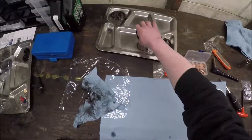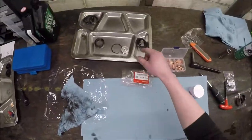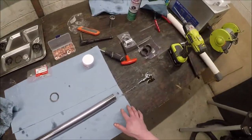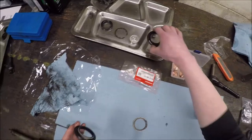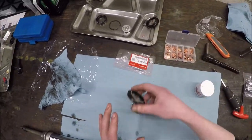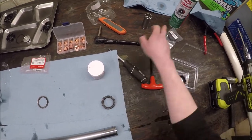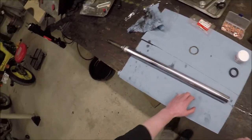So this is the old fork seal and I'm going to pull it off - these things are directional. I can't find another circlip but I did find a new damper rod bolt, which is the more important one anyway. The circlip actually looks alright now that I wiped it off. I'll bring the washer off and that's really all I have to deal with there. I've got a new dust seal and new All Balls fork seals. I also found those cheap four-dollar Four Into One seals - they look identical to the quality ones, but they're absolute trash.